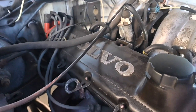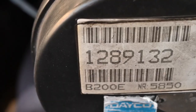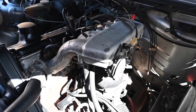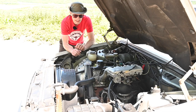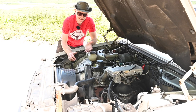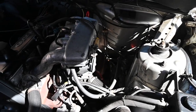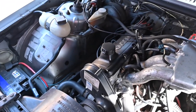This basic 740 entry level is a 2-litre, 1986cc four-cylinder non-turbocharged. It does have fuel injection with the Bosch K-Jetronic, which can actually be quite a nice reliable simple system. There are a couple of other options: the B230E which is the 2.3 four-cylinder giving a bit more pep, and the B28 V6 shared with Renault and more famously the DeLorean — not a great engine in fairness. Although there are only three basic engines there are 28 different variations, but this is probably the least powerful one.